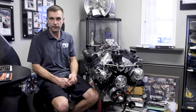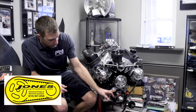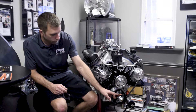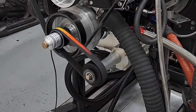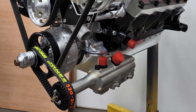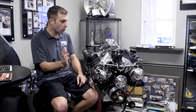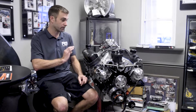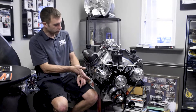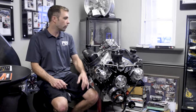Working with Daly and Jones, they created a pulley down here at the crank and a drive hub for the dry sump pump. Daly was responsible for the pan and the pump, and then Jones took over — we got him all the measurements so we could get everything set up perfectly. It was a breeze. We kept the look the customer wanted with the pulley kit, got the dry sump functioning, and then of course we went to the dyno.